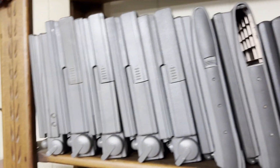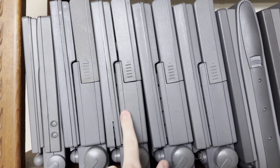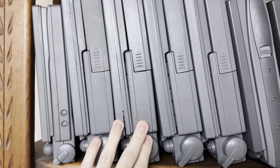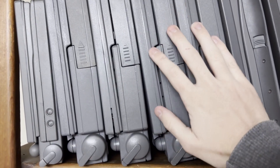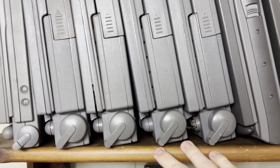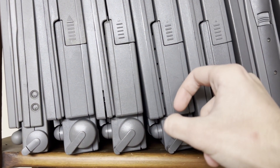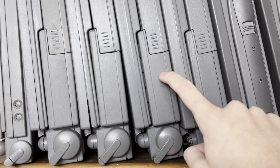Apple laptops: PowerBook 100 series - these are okay, except the 150. The 150 is an exception - this is brittle plastic disease because it was made by Acer. But all the other 100 series aren't brittle. The reason the hinges fail is because the plastic shrinks slightly with age, and they can't shrink around brass screw threads, so they crack. But besides the standoffs, nothing cracks on these - they're okay.